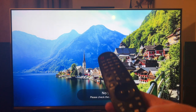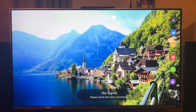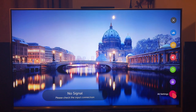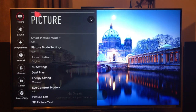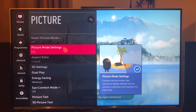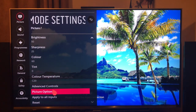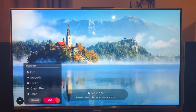If you, like me, have an LG Smart HDTV, this is how you turn off video interpolation to stop the soap opera effect. First, press the settings button on your remote, which is the one that looks like a cog, and then traverse down to all settings. Then go to the top and select picture, then click on picture mode settings, and scroll down to the bottom and select picture options.